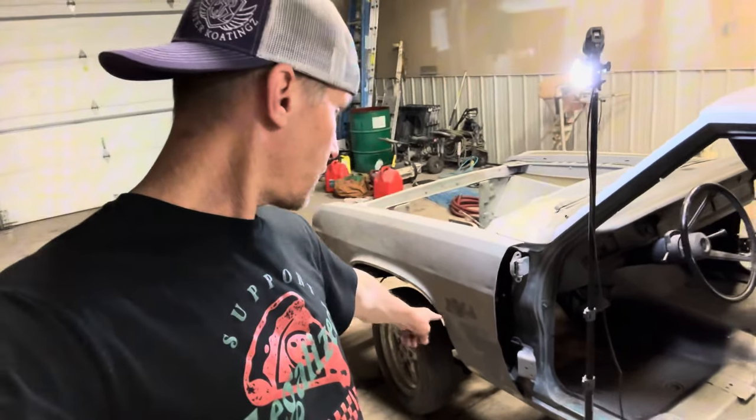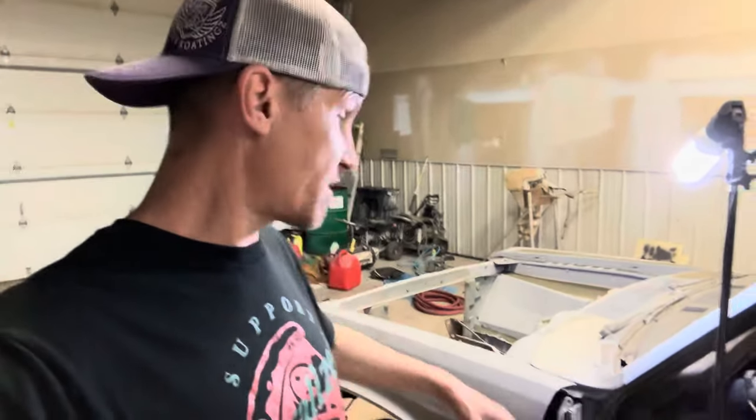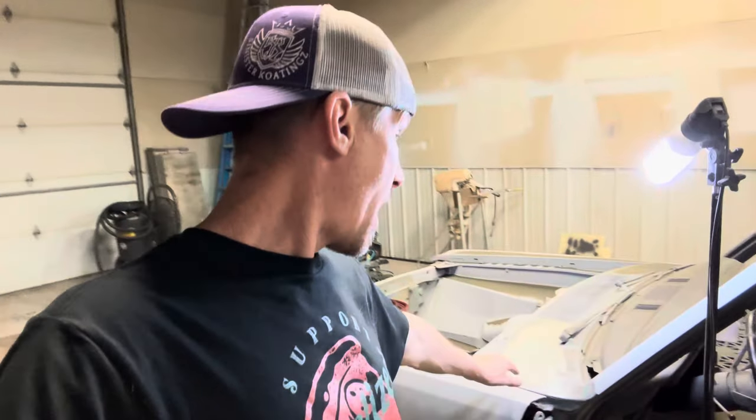As you just saw, I got most of this fender that we were working on in the last episode media blasted — there's just a little bit down in the corner I need to get. What I'm going to focus on right now is knocking out at least a good portion of this bondo and getting it sanded down to bare metal, since this is the area Alan is going to be working on tonight. It's been raining outside — it was raining yesterday, it's raining today — and media blasting in the rain is just not ideal. So I'm going to knock this out with a putty knife, use a mallet or hammer, then get it sanded down.